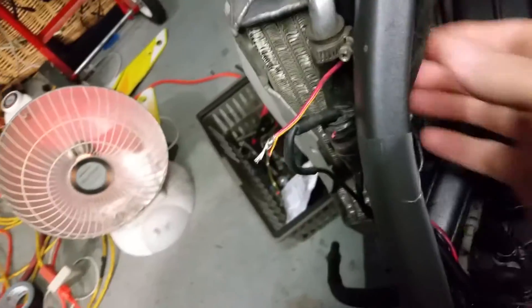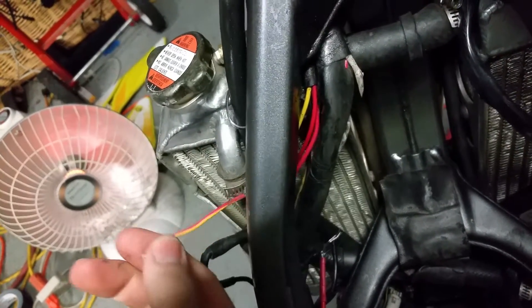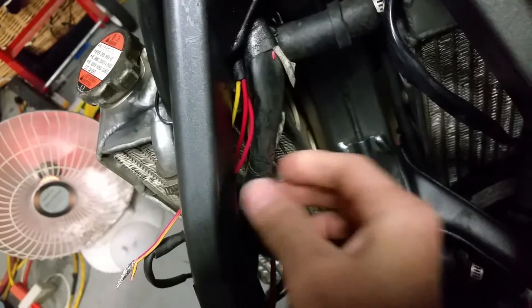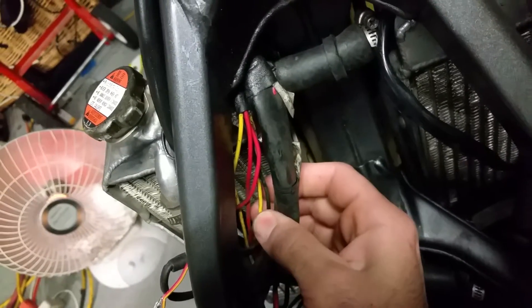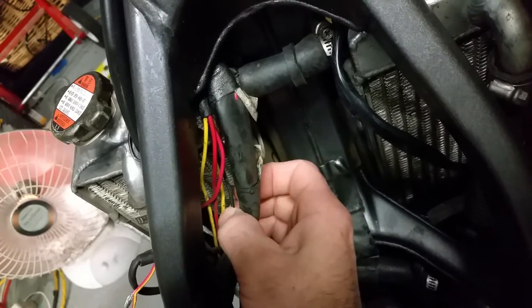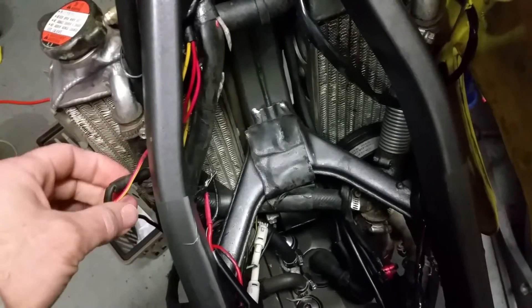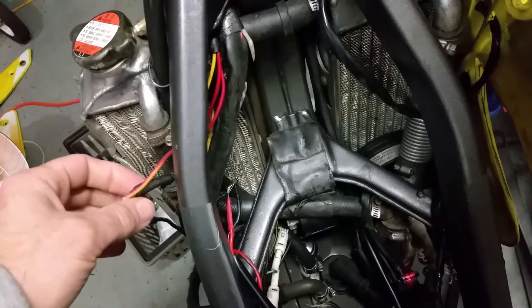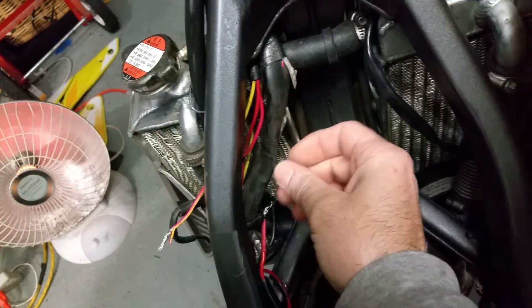There are also wires coming off the regulator/rectifier, and I believe this one is an auxiliary output — I'm going to try to hook the light up to that one. It's been a year since I've done this, but I had it all taped up and had to take it apart to hook up the light, so I figured this would be a good time to shoot the video. You have to run a capacitor or a battery in order to stabilize the power — I tried it without and it was acting too funky, only getting like 3 volts or something; it wasn't working.